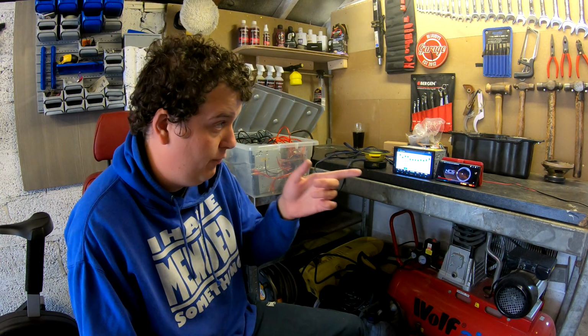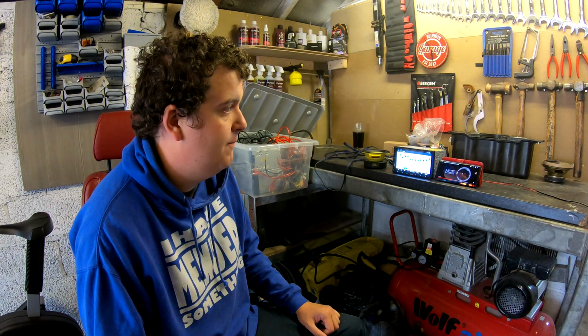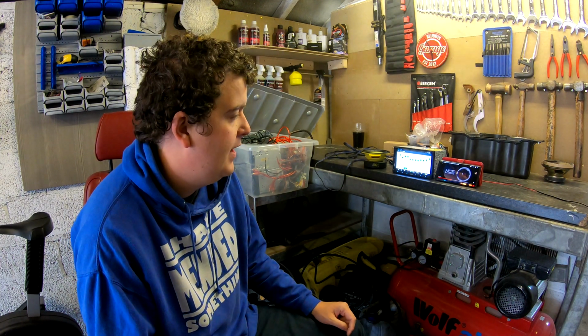So I need to make a ring for it. I need to make a template because I ain't got a template. So I can make a template, cut some wood out, get it mounted in the box, but I'm still waiting on some more cables to come, because I'm only running one set of RCA leads from the head unit to the back. So I just need some splitters that split the RCAs from 2 to 4, and that's what I've ordered. So I can go ahead and get this all made up, but I can't get it into the car yet because obviously I'm waiting on said items. So I need to get my jigsaw out, I think, and my drill.